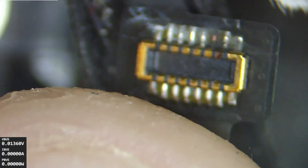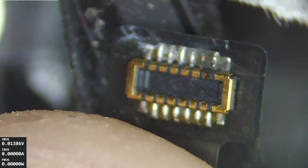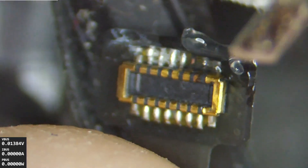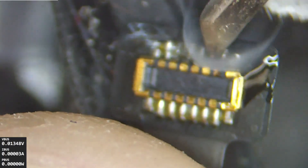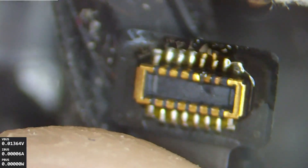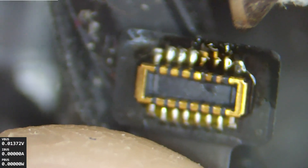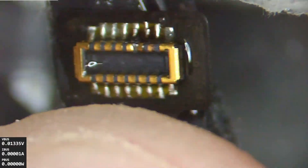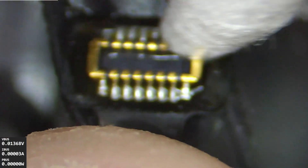Let's get a little bit of flux on that. I look at my fingers under the microscope — I need to moisturize. I don't have time for moisturizing right now. Is there a pad there? It would seem there still is a pad. So I just kind of touched up the solder, and that's probably fine. Hopefully. As if that Touch ID button is, like, damaged internally or something — this person's kind of out of luck for getting Touch ID working, because Apple says you can't fix that, you've got to replace the whole computer. Because really the solder joint's fine, so it should be making a connection. That 16-volt did short to ground, so maybe it killed our actual button. Probably not. We'll see.